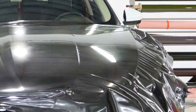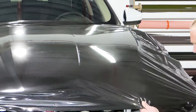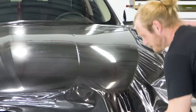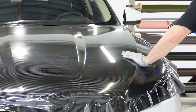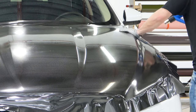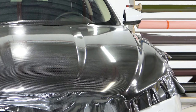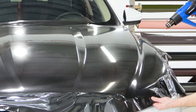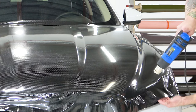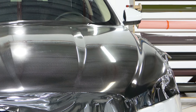Do I really need to add heat? Honestly I don't think so — I think I can pull a lot of this without even adding any heat. Let's heat and push through. Before I get to the ends I just want to make sure I have no tension on the edges. I've got a little wrinkle right here so I'm going to pop that area up, pre-shrink it again. I'm just going to hold the film — it just goes away. If we have no tension on our edge, the vinyl can't fail.